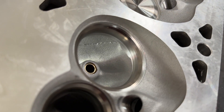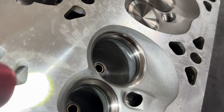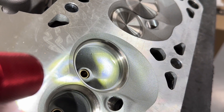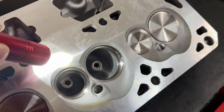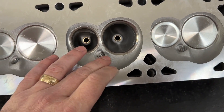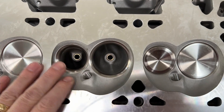If you grind that material out you'll probably gain some more flow. Probably the biggest thing you could do to gain flow is take it to a machine shop and have them redo the valve job, because remember AFR didn't do that valve job on the Enforcers — that was done in China using basic valve angles. If I put it on my machine with a custom cutter valve job, I'd gain probably 10-15 CFM right away, and blending will help too. The chamber is much better than stock — it looks a lot like a Dart chamber — much better than the 243 chambers.